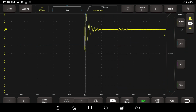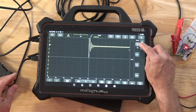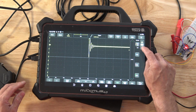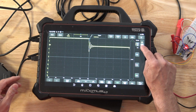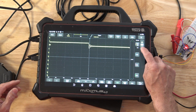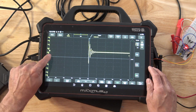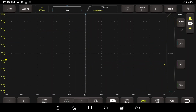Now here's our channel 1, and taking a look at this, I want you to know that we don't actually have a voltage that we can choose from. So this is our channel 1 voltage menu right here. You click on the lower icon to decrease the pattern, which is actually increasing the voltage. So if you need the pattern smaller, click on the smaller icon. If you need the pattern larger, click on the larger icon. You can also drag this little arrow over here. You can drag this up and down to get the pattern on your screen.